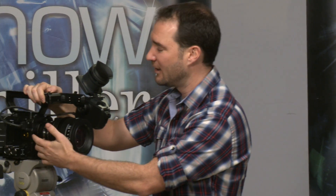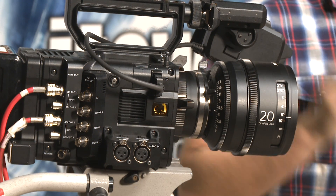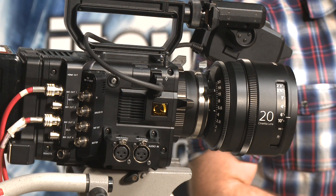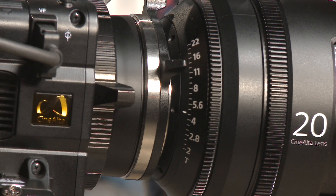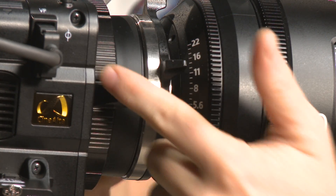The only way you can tell physically whether you're shooting on a PMW-F5 or PMW-F55 is the color of this ring right here. This is a Sony FZ mount. A couple of quick things: it's totally awesome, and it's a shallow flange, which means you can adapt it to Minolta, Leica, Nikon, Canon — whatever lenses you've got. Most importantly, Sony has included in the box of both the F5 and F55 a PL to FZ mount adapter, so you can use Sony's 4K PL mount lenses or all standard PL mount lenses. The ring on the F5 is black; on the F55, it's silver. Otherwise, the form factor is identical.